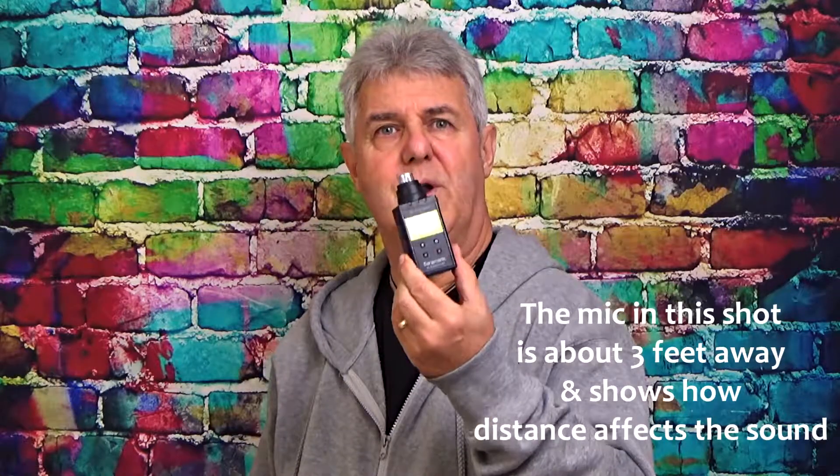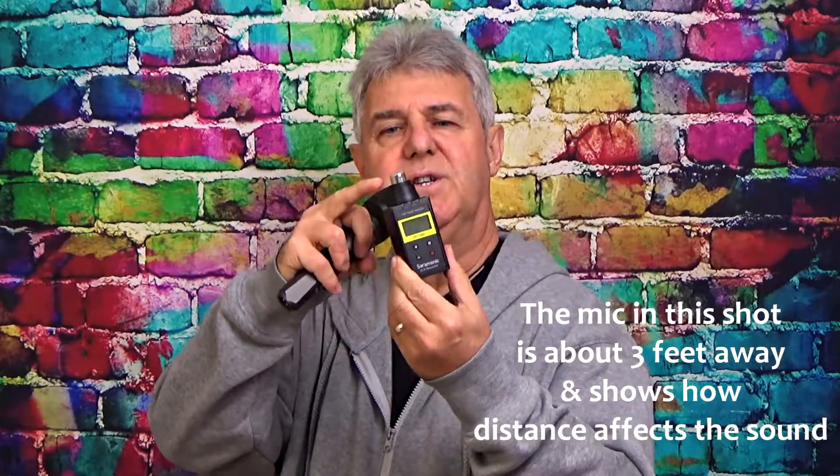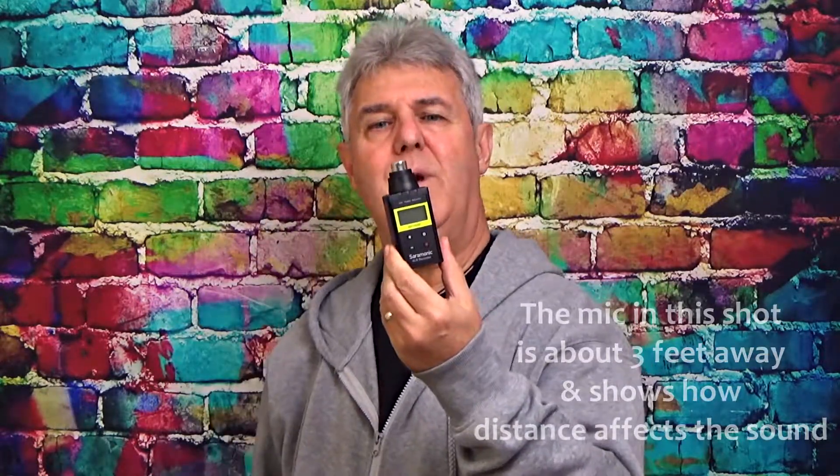To connect the Saramonic recorder to your microphone, there's a female XLR socket at the top and it's spring-loaded. When you push down on it, it locks so that the microphone won't come off. You just line up the pins, get your microphone, line up the pins, and push — I use my body because I don't like to push on the cage of the microphone. Push until it clicks and it's now fitted, rock solid. It's not going to go anywhere.